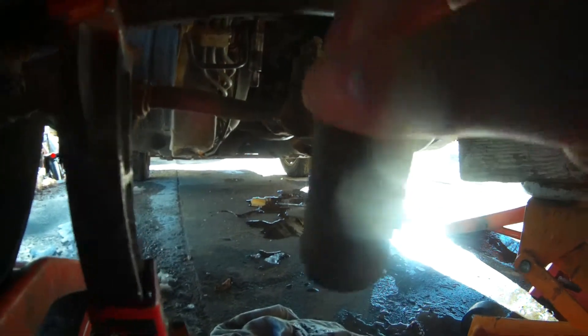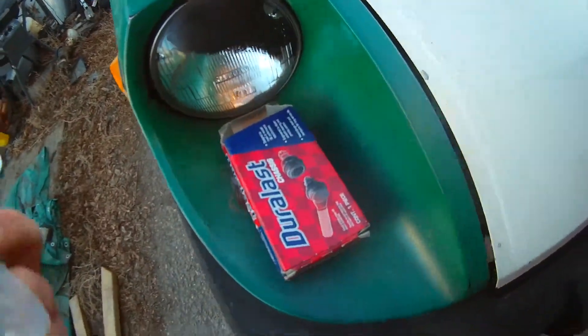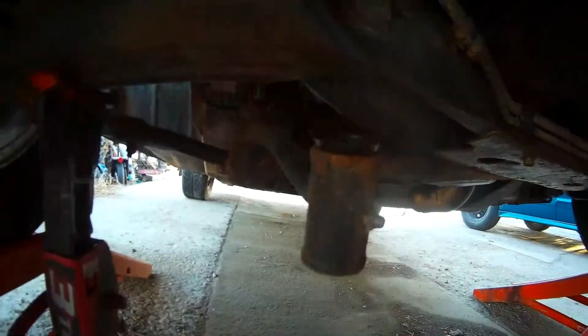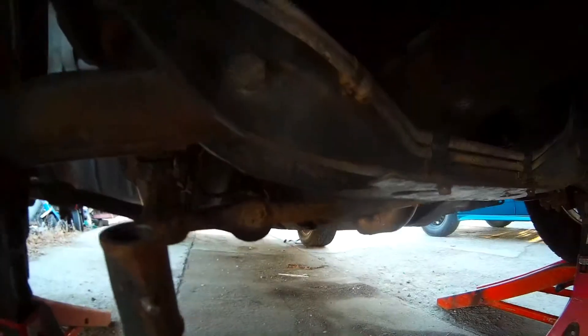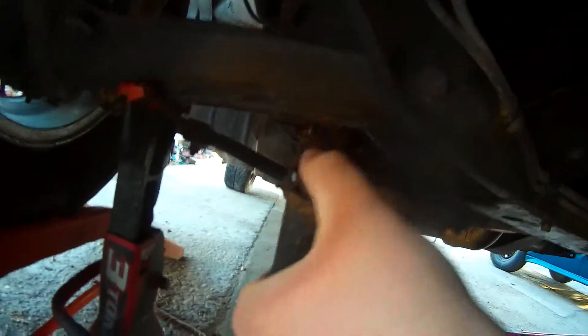It's been a week since I last got to do this. I got a new bushing kit and we're going to install it today finally. I'm going to take the other bushing out, put it to the side, make sure these ones line up with the one about to put in — which it does. I'm just going to put that one there, put that one there. They seem to stick out just a little bit, which I'm just gonna push down.